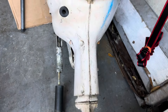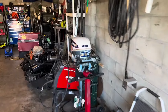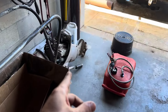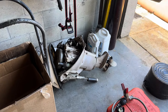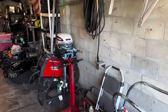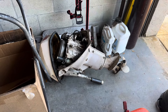So farewell. If I can rob the coils out of this — again, this is a 1964 — if the '64 coils will work on the '76, then I'll throw them in here and bring her back to life because I know that has good spark and it's actually got decent compression. It's got 70 PSI on both cylinders. That's not the best compression, but it's also not the worst compression. So that's where she may end up. If she can help me keep the four horse alive, I'll do so. I think I already have it posted on marketplace for like 150 bucks as a parts motor.